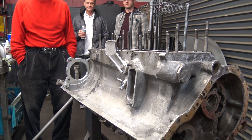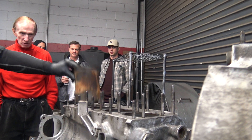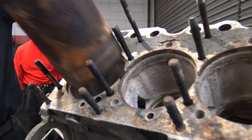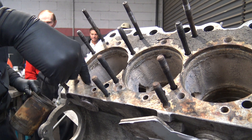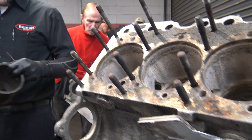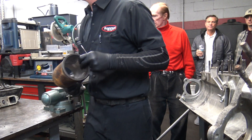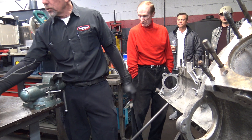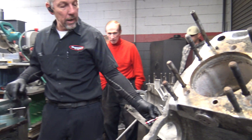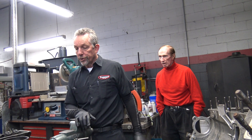This is an aluminum block that has cast iron sleeves that go inside of it. You can see right here — these will slide in there, they're hard to get out when they've been in there a while. Inside there are O-rings: a big O-ring up on the top, a small one, and another one down below, which seals the coolant in these passages. There's another O-ring down below which seals off the crankcase, which will have some pressure, especially if you have a lot of blow-by.